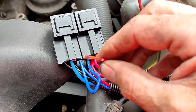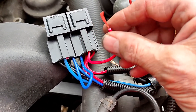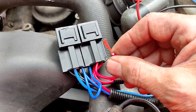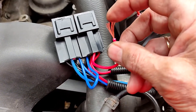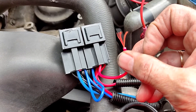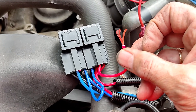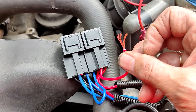There's probably not as much copper in this as I would have liked either, but maybe I'm a bit of a perfectionist in terms of cable gauge. The whole idea of this is to reduce resistance in the cable and get as much current as possible to the bulbs for high output. Realistically I'd have liked to have seen a little bit more copper, but it's better than what was there before. Certainly taking the high current switching away from the column switch is a big plus, but some chunkier cables would have been nice.